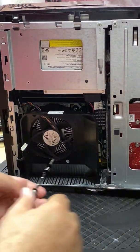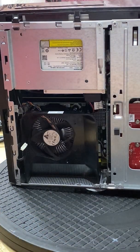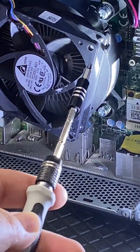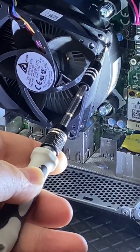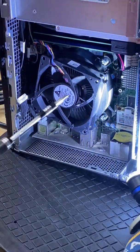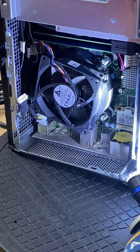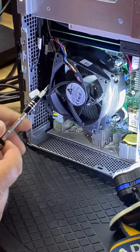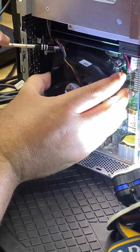I'm going to reverse the airflow — take it from an exhaust to an intake fan. First thing I'm doing is taking off this fan shroud. There are four clips to take the fan off — you can see the retaining clips right here. You put a little pressure with a little leverage and pop it off, but don't do too much or you might break the clip. There are four locations for the clips, so I'm going around and loosening each one little by little and then I'll pull up at the very end.